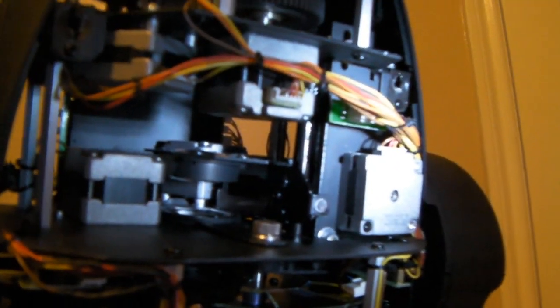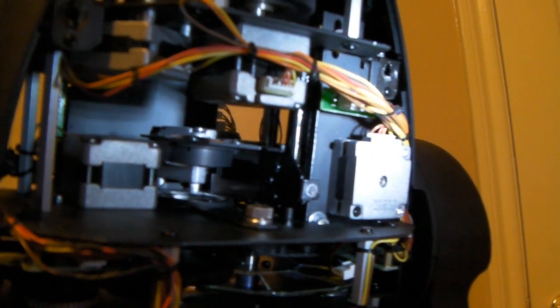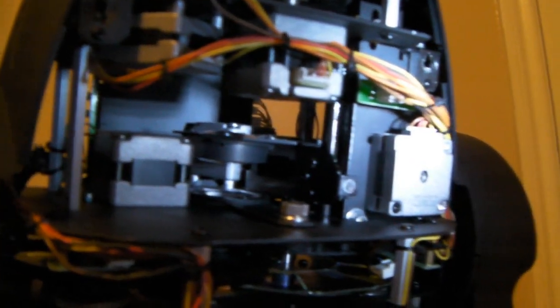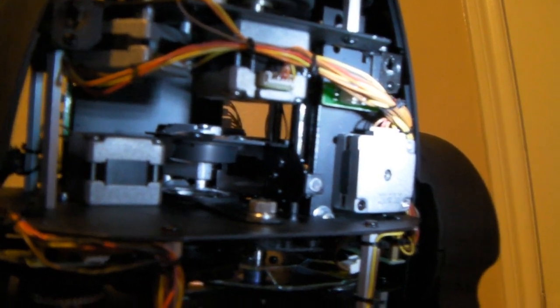This happens with a lot of different light fixtures. You have to replace these focus lenses. So if you have a moving head or any scanner that has motorized focus and it's out of focus all the time, and you wonder why the colors are off a little bit, you think you're just gonna wipe the lens off? I don't think so. You gotta replace the focus lens. There's like a piece of gel on it in between the glass of the lens. So it's like two glasses put together.